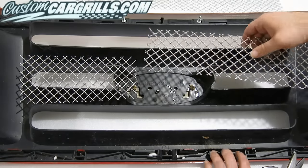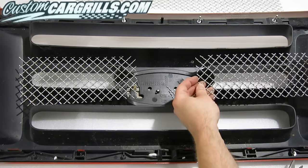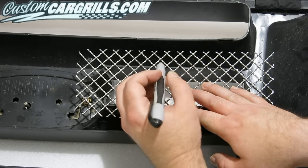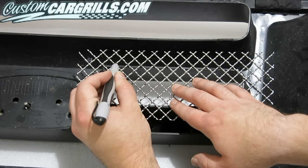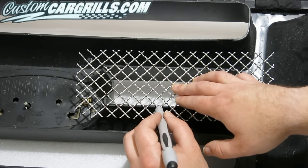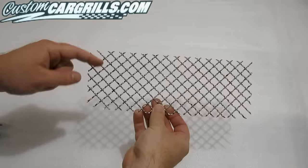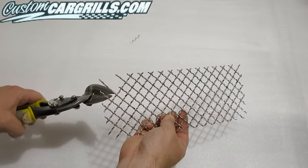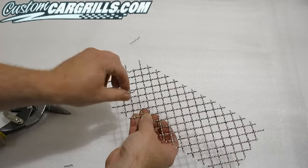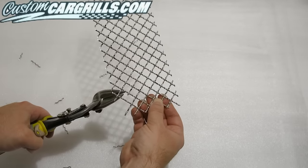This is the aluminum woven wire material and as you can see, it's very easy to cut with just a basic pair of tin snips. Next, we'll need to form the mesh so that it contours over the back of the opening. It's usually best to mark off the shape of the factory opening — this way you'll have some sort of point of reference as to where to bend the material. Oftentimes I find it easier to mold mesh to the back of the bumper when you cut corners out of the edges. This will give you a defined top, bottom, left, and right area that needs to be folded.